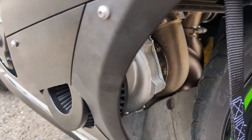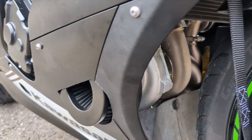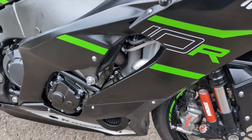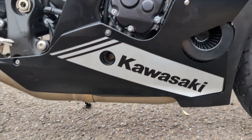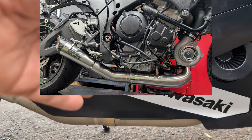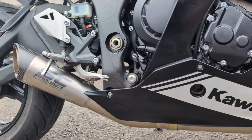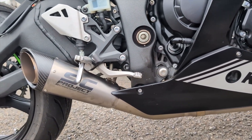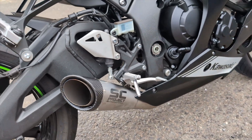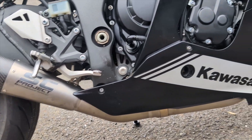We use a Pulsar 2860 turbo with a stainless steel exhaust housing. This has got a little air filter poking out the fairing there. It has a 3-inch exhaust that finishes at the point where the factory header finishes, so you can run any aftermarket muffler. In this case we've chosen the SC Project because it's the most open exhaust and it uses a 70mm link pipe, which is the biggest diameter we could find.